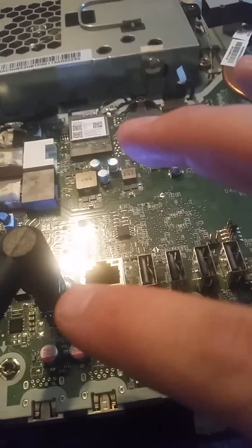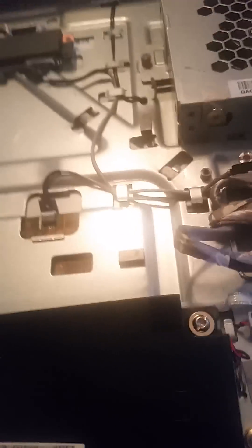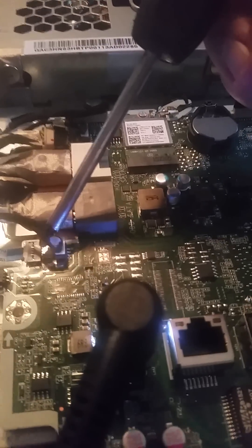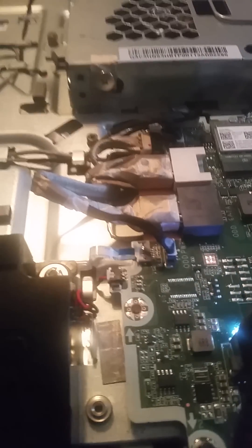I'm not 100% sure about that, but I couldn't find any actual videos on it. What I have here is the HP 23 all-in-one with the cover removed from the top. Down here is your power plug and your power switch. They're talking about this switch right here — you can see there are four pins that go to the motherboard. Using a flathead to touch them shorts the switch out, potentially allowing the machine to power up. I did that a couple of times and all that happened was my power light went out and nothing happened. So I followed the cable all the way over to the switch.